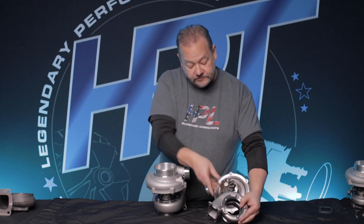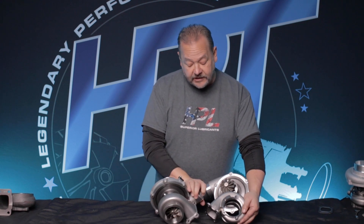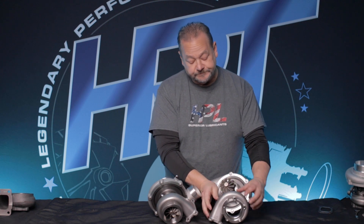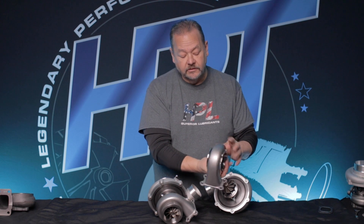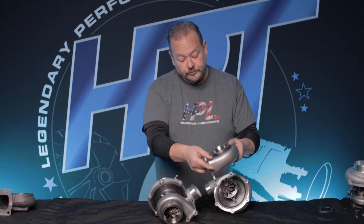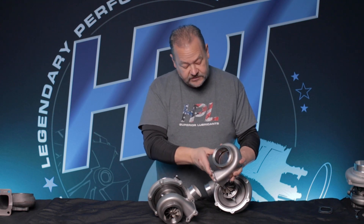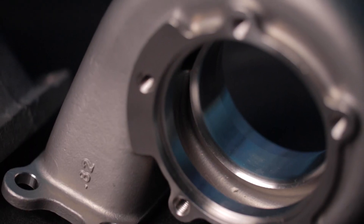This is an 82 housing; over here is a 6.3. They look really tiny, and I'll tell you why — it's because you can get rid of all that bulk on the outside. This is 310 stainless. It's going to contain the wheel, but we can get rid of all that extra mass of an iron housing. Additionally, we've got a really nice flare on the backside of these to help the expansion ratio of the gas as it comes out of the turbine wheel.